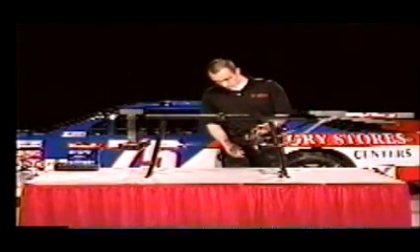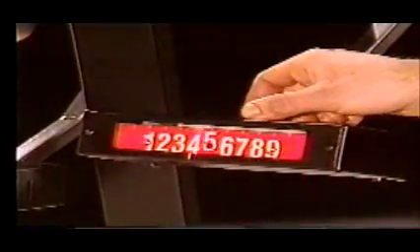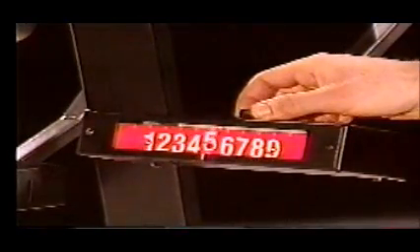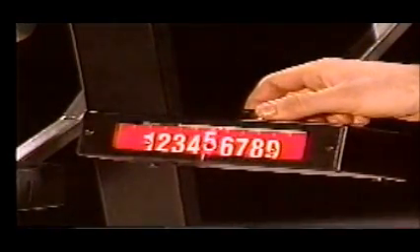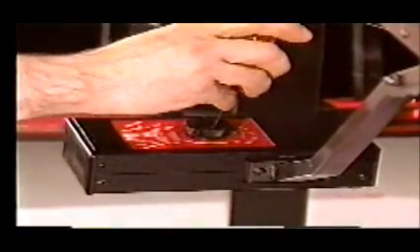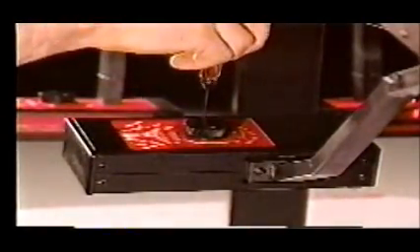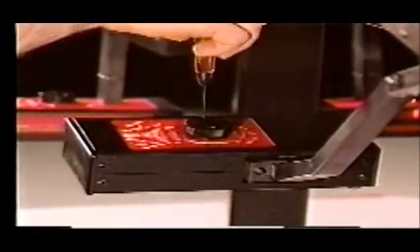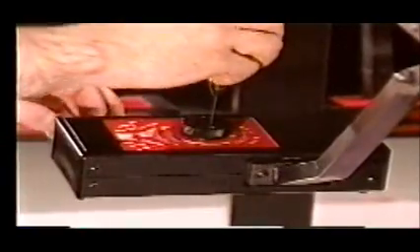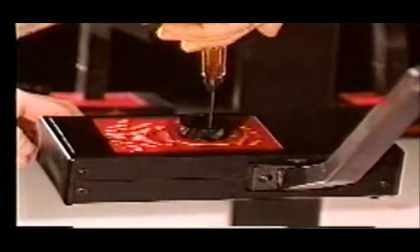The object here is to make the laser reflect back into its hole at the number five. If the laser beam does not reflect back into the hole, the technician adjusts the beam by moving the toe adjustment knob on the top of the laser box. The technician then loosens the knob using a 1/16th inch hex key and turns the dial ring until the line is on zero, verifies that the laser is in the hole and the dial ring is on zero, and then tightens the knob. The technician repeats this procedure for the other laser gun.